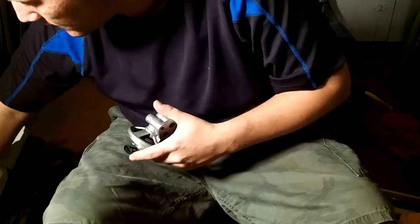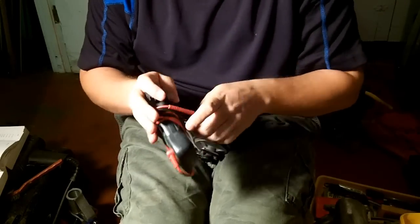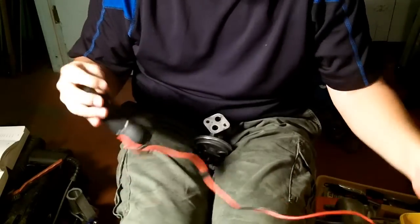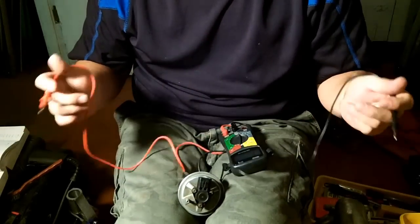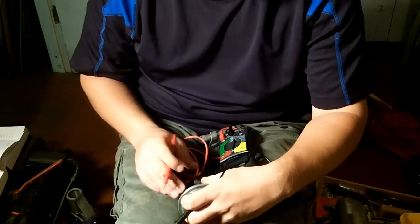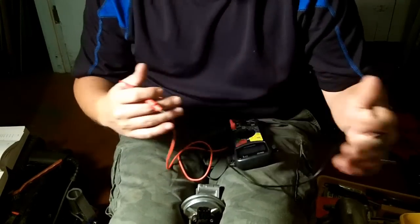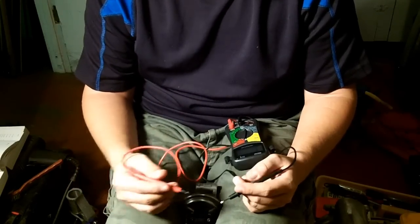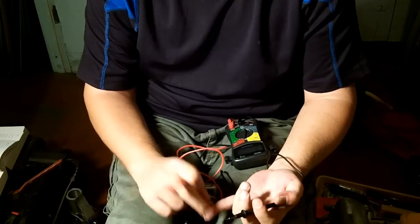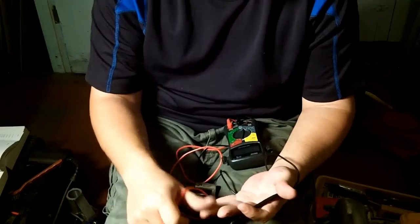Now we will whip out our multimeters. You will need a multimeter. A lot of the testing for the EGR system, you will also need a vacuum pump. I do not have a vacuum pump, so make sure you check your manual. This video will be posted on Mazda626.net as a very lengthy how to test your EGR tutorial, and it will also go into testing for i4s versus V6s, ATX versus MTXs, 4th gens and 5th gens.